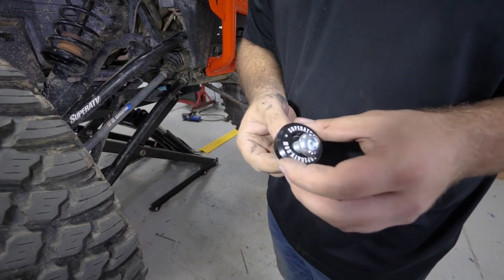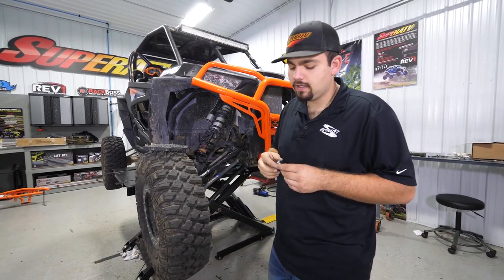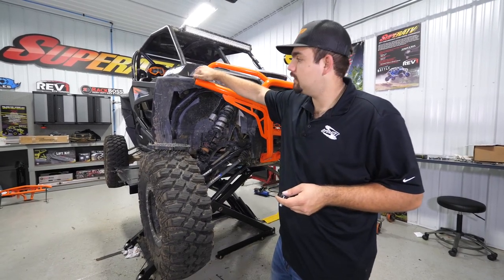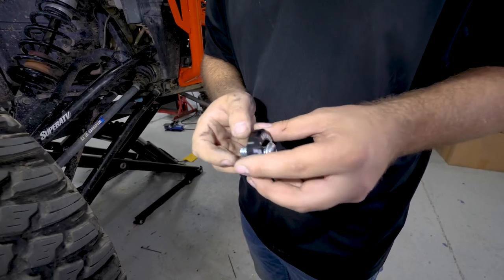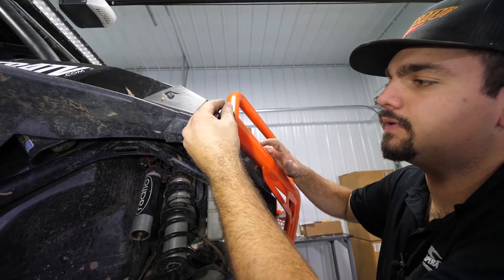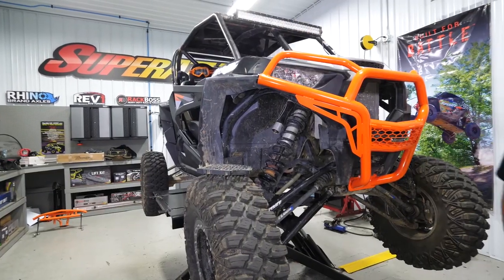The last thing we're going to do is install our end caps on the end of the bumper tubes, since today we aren't installing a full protection kit. If you have or are getting a full protection kit, it would install onto this threaded portion of the bumper tube. For now, we'll just use our M10 Allen-headed hardware and cap, thread it into the end of the bumper tube, fully tighten it, and do the same on the opposite side.